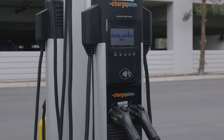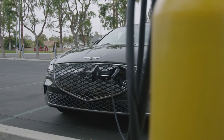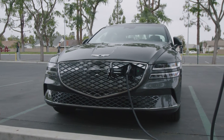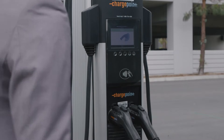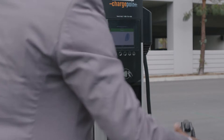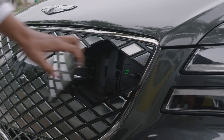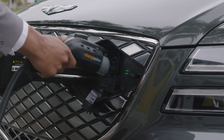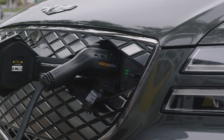The next type of charger is the 240-volt Level 2 AC charger, available at various public charging stations and properly equipped households. Level 2 AC chargers can charge in as quickly as almost a quarter the time of Level 1 AC chargers, but require high-voltage outlets for household use. These outlets are similar to what a clothes dryer would use and may need to be installed by a certified professional.